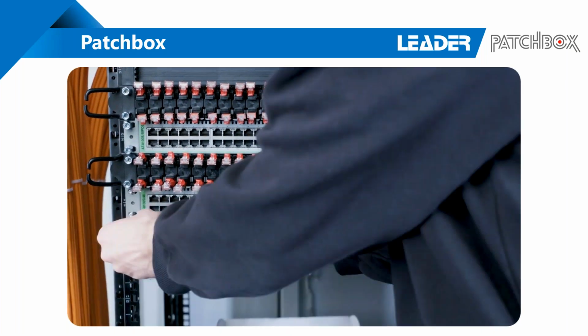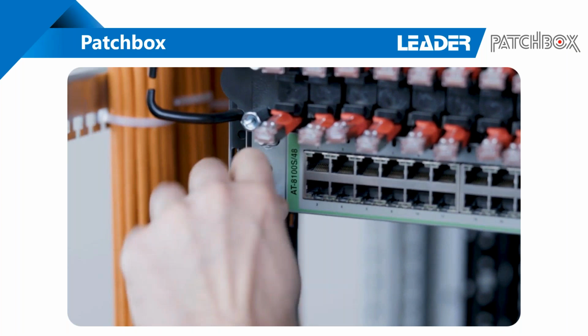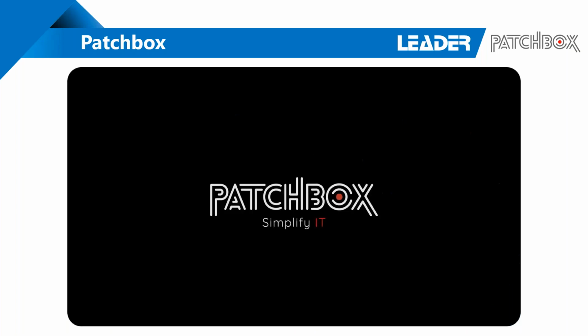The next best thing about them is they're totally toolless. You don't need a Phillips screwdriver like you would with the traditional cage nuts. They all come with these hand-tightened hex bolts. Now, hand tighten is usually more than enough. I've actually used these a couple of times myself, and I can tell you that hand tightening is usually more than enough. But if you do want to tighten them up a bit more than that, you certainly can do. It's just a 10mm spanner, and away you go.